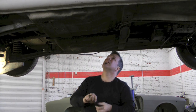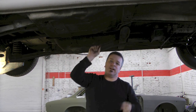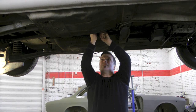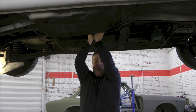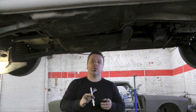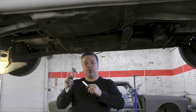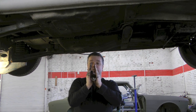When you're doing this side, put the bolt coming from the first shaft going through to the second shaft. On the first shaft side there is no room for a nut and a washer on what we'll call the north side. The driveshaft is in but not bolted down completely — it's still loosely bolted. You can't just go snugging this thing down; you have to use a feeler gauge. Make sure you're bearing down on this thing equally so that when it goes flush, it's not slightly askew on the bolting locations. If you have one bolt slightly loose compared to the rest, it's eventually going to work itself out once it becomes loose.